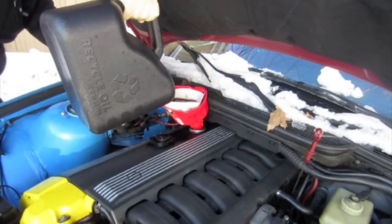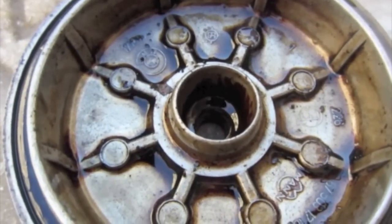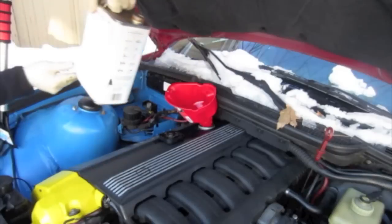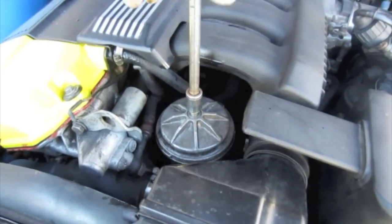The filtered oil then went through another new strainer and back into the motor for another cycle. We repeated this cycle several times using new strainers each time, and while we're at it we took time to clean off the oil filter housing cover also — as you can see, it's still filthy. With everything as clean as we could get it, we're upping the dosage of seafoam. The ratio calls for one pint for 10 quarts of oil, and as you can see here, we were very scientific. The strainer from the last cycle doesn't look a whole lot better from when we started — there's still a ton of stuff floating around in this motor. With attempts almost in the teens, we decided to throw in a new filter and call it a day. Let me know in the comments how long you think this motor will last.